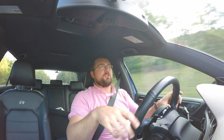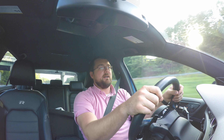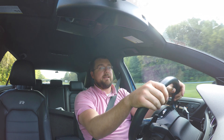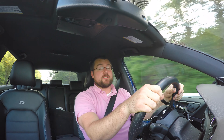My second thought was: I want to know if with the new Bull-X downpipe on, the flutter goes away because the exhaust gas is now going in the right direction. But I just did a launch there — just flooring it — and I heard the fluttering again, first to second gear, and again when I let off the gas at 65 miles an hour. That's a little concerning.